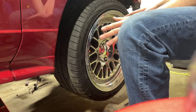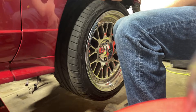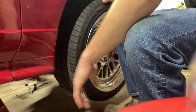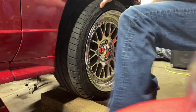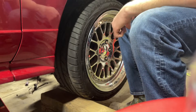Here's a little trick that I've learned. If you have a car up on jackstands and you've forgotten, or maybe you didn't intend to take the tires off, and you need to break the lug nuts free and you don't have an impact available — I do have an impact but it's not here right now — you can take a block of wood, set it up under there, and when you go to break them it'll catch on that wood so you can remove them.